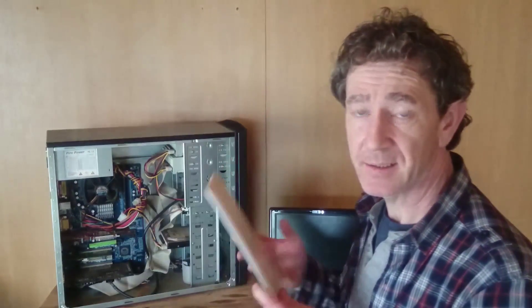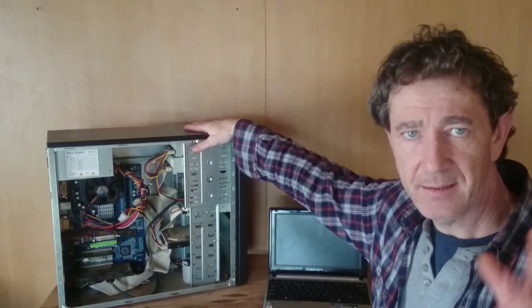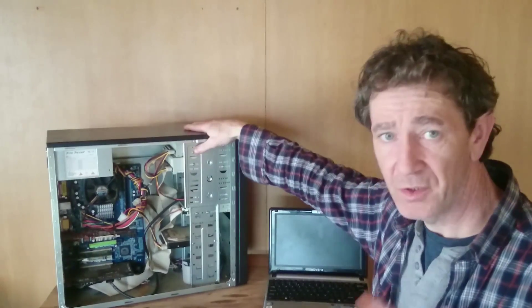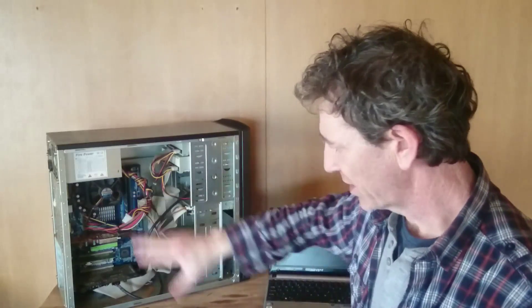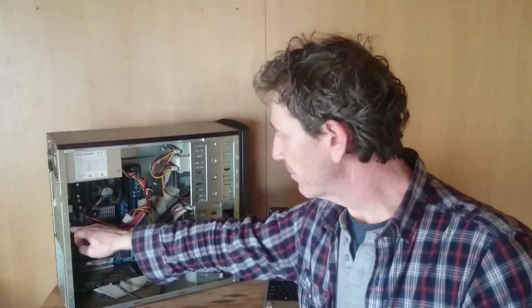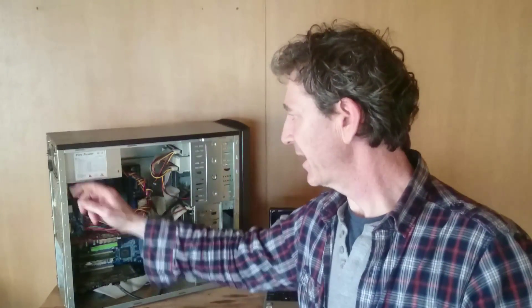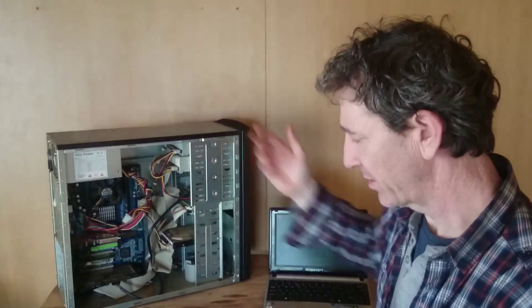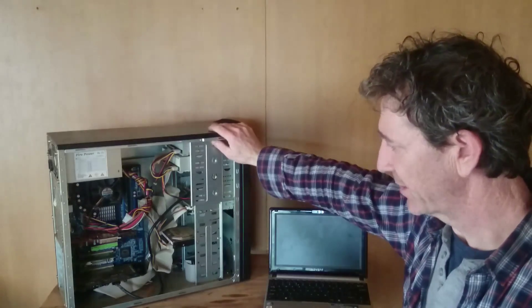The same thing goes with some tablets and phones as well. The desktop is a different kettle of fish altogether. Some Dells, HPs, Gateways, and Apples can be upgraded to new boards if the back of the PC is shaped to fit a standard motherboard. But with the Dells and some HPs, they shift the back input/output ports to the opposite side, so generic motherboards won't fit. You'd have to cut the case apart to make it work, so custom cases are the only way to go if you want to renew a PC.